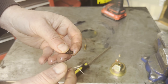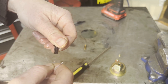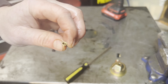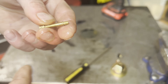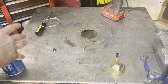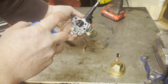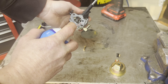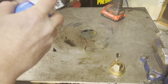And the pilot jet — same thing. There's a little hole right here in the tip. Make sure the wire goes in, which it does. That is good. And we got the emulsion tube. You can actually see right in the tip there's a little bit of buildup, and then there's all these little holes. So I'm going to take my wire and poke it through each one of those. Then I just got some carb cleaner and I'm going to spray it through this passageway. Make sure it's going through where it should, and it is. Same with this guy, and I'll spray a little bit down here.